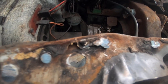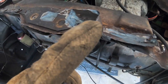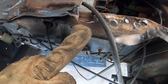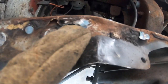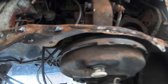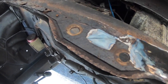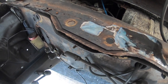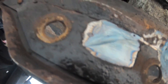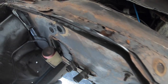What we're doing here is separating the panel — the cowl lower and upper — from the firewall flange. We're left with these plug weld spots, okay, spot welds. So what I'm trying to do is grind down the welds so thin on the cowl panel that I can just break off the cowl and leave the firewall intact.